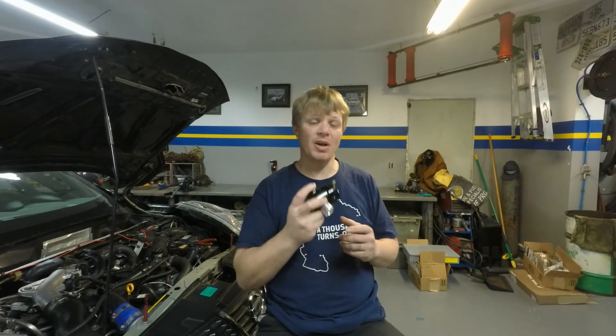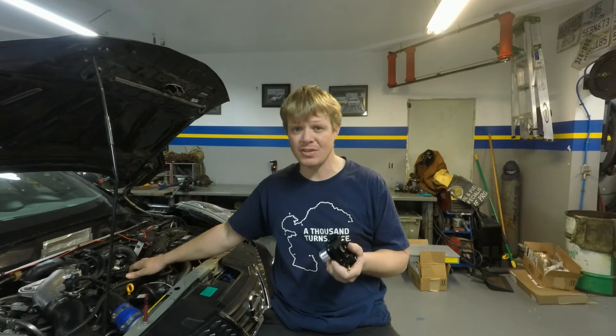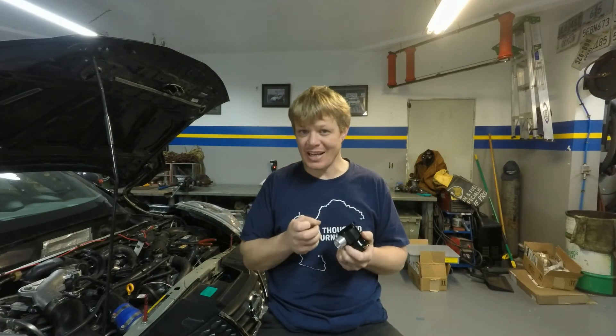The product we're going to be using from Go Fast Bits on our Nissan Juke today is their Response TMS dual-port BOV. What makes this BOV different than a lot of others on the market is its ability to give you performance and sound without compromise. This valve has a very precise adjustment that gives you the ability to either vent 100% of boost pressure to atmosphere, giving you that cool turbo sound, or recirculate a little bit of that air back into the system, keeping the check engine light happy and turned off.